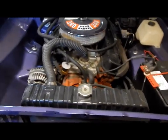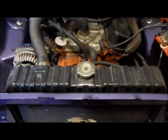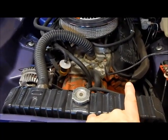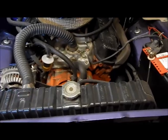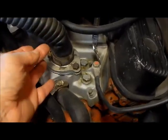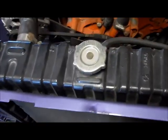The point is getting these cars back to original — what it takes. Let's look at my underhood here. The first thing you might see is a flex hose. The reason for the flex hose is that is a six-cylinder radiator. A V8 car will have the water outlet over here. So my options there — I pulled this out of a junkyard years ago when I was young. I didn't know the six-cylinder versus V8 had the water neck on the wrong side, but I don't like the flex hose. One of the main reasons is it's kinked right here.